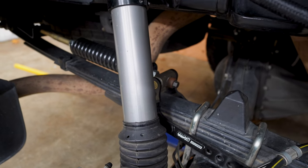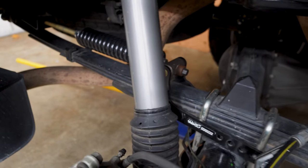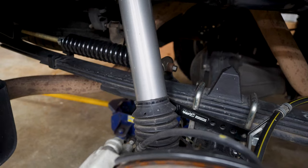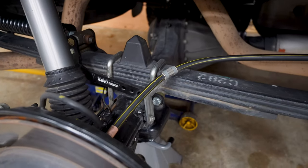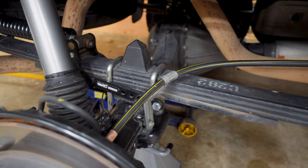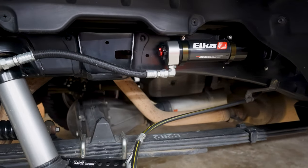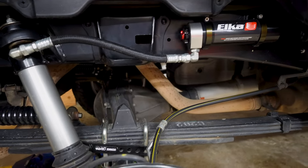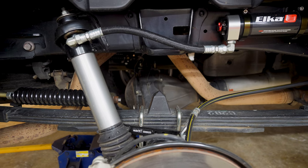I didn't want it too stiff, so I found a happy medium - I think I used a nickel for the spacing. It ended up raising the truck about a half inch in the back, which I estimate is right around 30%. That has worked well and handled the weight of the camper very well. Part of the reason I went with the RAS kit and not airbags is I didn't want to deal with running airlines and having to pump those up. Also with this truck I've set it up for off-road use to some degree, and I was afraid airbags would really stiffen up the ride.